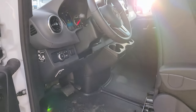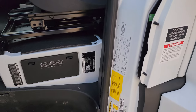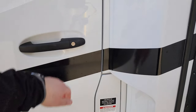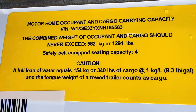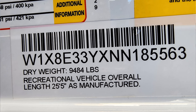The driver and passenger seats do flip around. On the side of the door frame there are some very important informational stickers. The first one is the main production data sticker with production date, VIN number, and other information. Next is the cargo carrying capacity sticker, basically telling you how much gear you can load into the RV. Then a tire sticker showing tire size and most importantly tire pressure — very important to keep up with that. There's also an unloaded vehicle weight sticker telling you what the RV weighed empty at the factory.